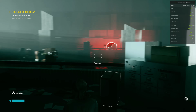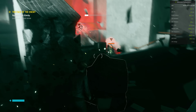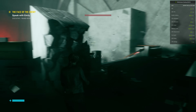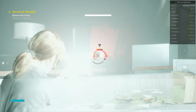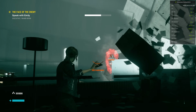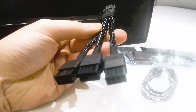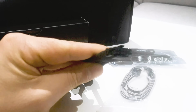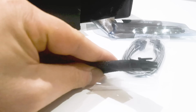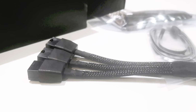And now we've got access to Power Maximum. The 100% value is the default value. Some 4090s will allow you to go higher than 450 watt TDP, and that's due to a couple of things being true. One, the manufacturer uses a custom BIOS allowing their values to be raised, and they're using a different type of 12VHPWR than our card here. The basic difference is that there's 4 PCIe power cables linking it rather than the 450 watt limited cards of just 3. You can bypass this limit with a 450 watt only card by flashing the BIOS and buying a separate cable. Perhaps I'll cover that in another video.